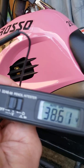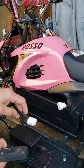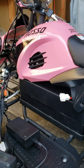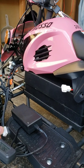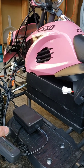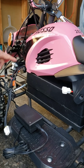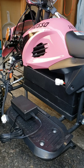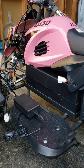If you don't have 38 volts, that means your battery has a low charge and needs to be recharged. Maybe you have a problem with the charger — why it was not charging before. Maybe it's been sitting for a long period of time, like over the winter, and you did not plug in your ATV once a month like you're supposed to, so you did not maintain the battery charge level.